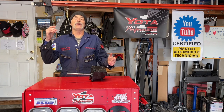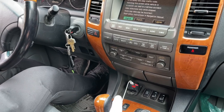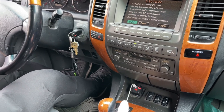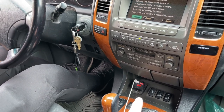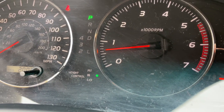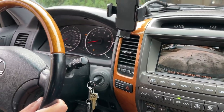We're going to get Viet's rig into the garage, jack it up to get all four wheels off the ground, and start diagnosing the system. Before we do that, we're going to test it by moving the vehicle back and forth with the center diff lock engaged to see if we feel that the locker is engaged or not. We have the vehicle on. Viet's going to push the center diff lock button — you'll see it's blinking but not going solid. Now we're going to back up, turn the wheel, and see if we can get it to lock.